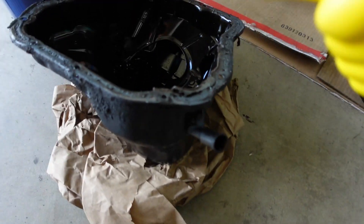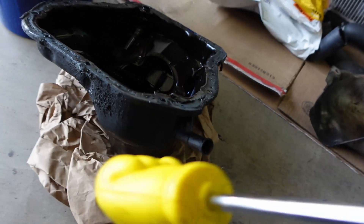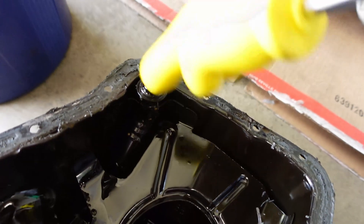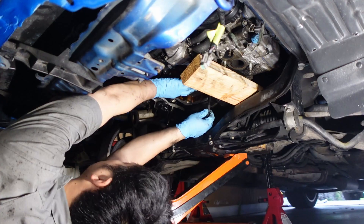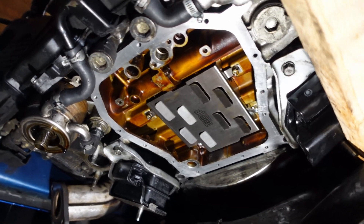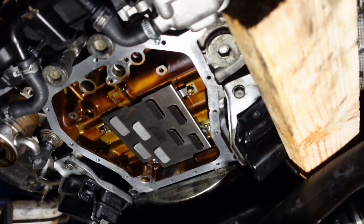This pan is pretty dirty, so I'm going to clean the crap out of it — all the sealing surfaces, inside, make sure there's no gunk. Clean the outside as well because there's a bunch of sludge. There is an O-ring right here — I bought a new one, so we're going to replace that. Then cleaning on the block as well. IAG windage tray installed — pretty straightforward. I reused the two front bolts that are OEM, and they provide you with two bolts for the rear.